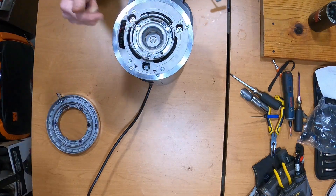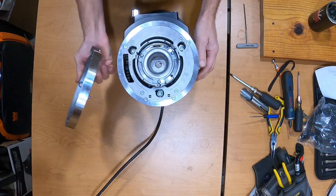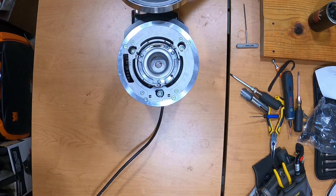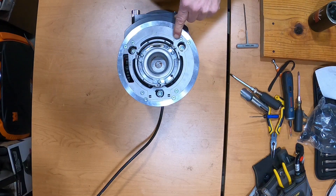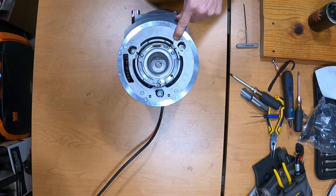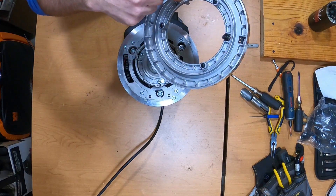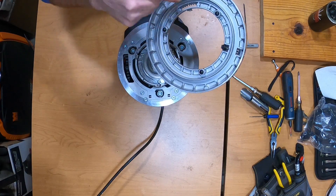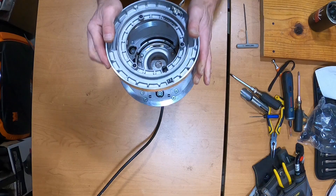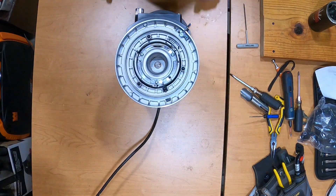Leaving it right there — that's calibration. To put the adjustment ring on in the calibrated position, there's a small zero stamped on the body. You may or may not see it clearly, but it is a zero. When you put the deepest cutout on the adjustment ring — see there are all these little cutouts? The one in the middle is deeper — you put it on the zero and you're zeroed.